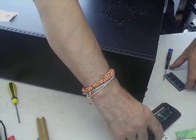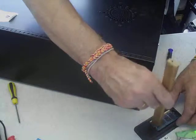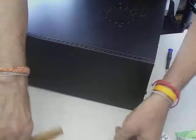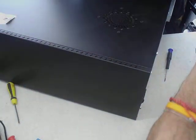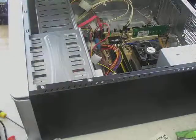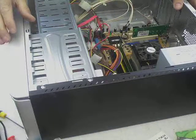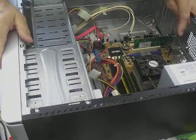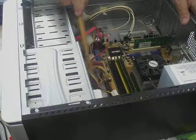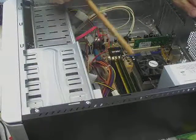Now for the tower. That's the dynamic RAM — there are two slots. We're going to take out two 512MB sticks and replace them with one 1GB stick. These white creamy-coloured clips here are what we call the retainers. The procedure is the same — if this were plugged in it would be charged up, so we unplug it, flick the switch on the back to zero if there is one, then go to the front switch and hold it in for at least a minute to discharge the capacitors.